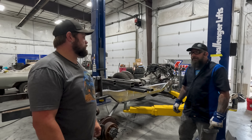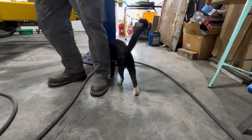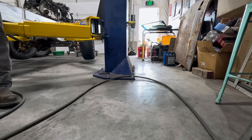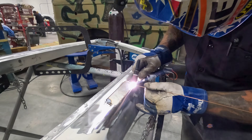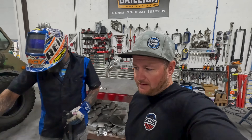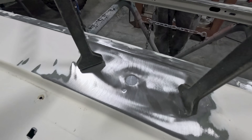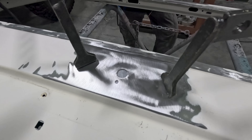My step is done — 320 on the whole deck lid and red Scotch-Brite, getting rid of any of the shininess. Where you still see shininess, that's where a dent needs to be fixed, so I'm not doing that. If you want to find the dent, it's easiest when the shine is still on it. The next step is Sean — he wants the brake light deleted and the wiper hole deleted. Sean is going to weld it all the way around — he cut out a piece of steel, it'll go all the way around, then he'll grind and smooth it out. On the wiper hole, that's just a chunk of aluminum — he'll fill that hole in with a weld, and the aluminum will take all the heat so it doesn't warp. And that's how you patch a hole — two holes.